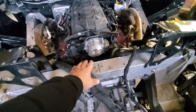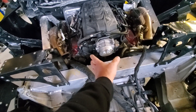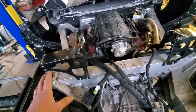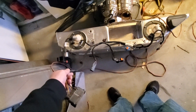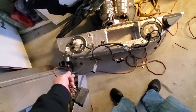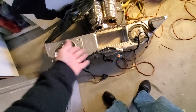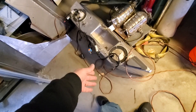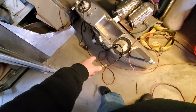The other thing is we've got an interference issue with the throttle body, so I'm going to have to make some sort of manifold and move the air cleaners where they need to go on either side. I also picked up the wiring harness for the two fuel pumps. I'm assuming these two pumps work, but we'll test them to make sure. Basically we've got ourselves a fuel tank — a standard fuel tank from one of these McLarens — that should go in OEM. I just need to wire up the harness to run the fuel pumps and read the sensors.